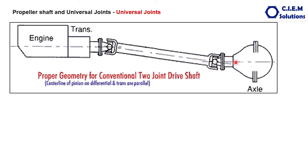As long as both axes are not in the same line, you cannot connect these two components with any rigid axle or rigid shaft. Connecting two objects of different axes with a rigid rod leads to breakage of the rod or any weaker component of this complete arrangement. So you need to provide flexibility here to take care of the difference in axis levels and difference in angle when you are connecting these components.